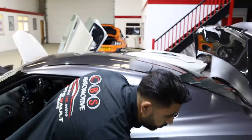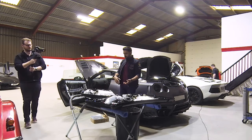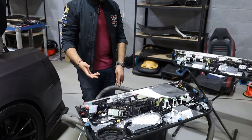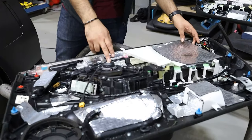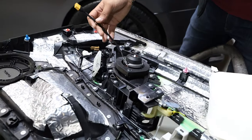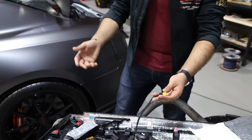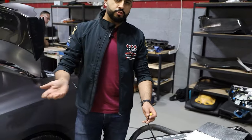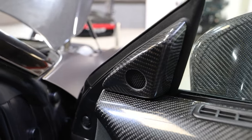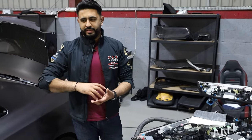I want to show you as well on the back of the actual door card itself. We've got the Bose grille — the car came with Bose from stock. So this is a soundproofed panel now. They had the 3-inch mounted into the door. Rather than having it bullet-connected, where most of the connections inside the door were all bulleted, what we've actually done is soldered those joins when they're placed onto the door. The tweeter, for instance, is actually built into the door — there's no need for it to be on a disconnected plug — so that's actually soldered in now.